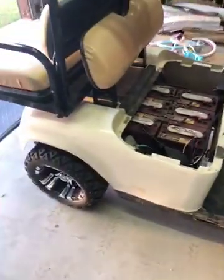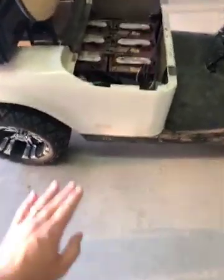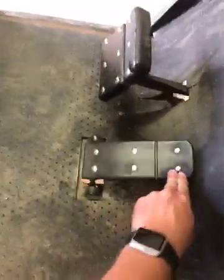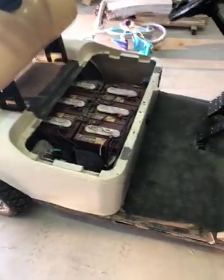This thing just about wore me out. I'd put it back together, try it again. Really, when I parked this cart north and south with the front facing north and the sun setting in the west, getting good afternoon sun on this floorboard, is when I would have the problem — the cart not wanting to work, almost like the key was off. I'd push the pedal, nothing would happen. There really wasn't anything I could do to make it work except just let it cool off. The next morning it worked great.